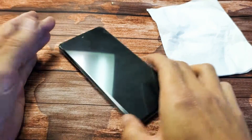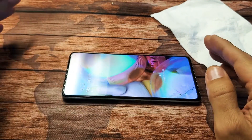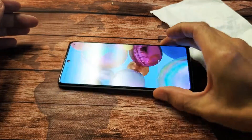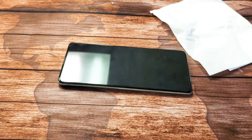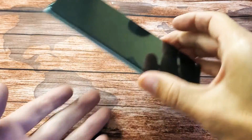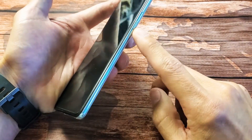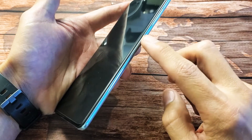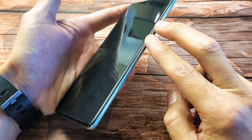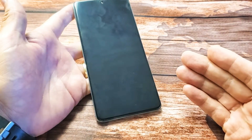If you're still not up, grab your phone and go to your freezer — put it in the freezer for about 10 or 15 minutes. Let it sit. After 10 or 15 minutes, take it out and you'll have a nice cold phone. Then do the same thing again: volume down and the power side button. Press and hold both buttons and wait till you see the Samsung logo appear. Hopefully you are now up and running.